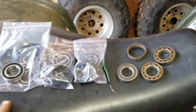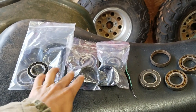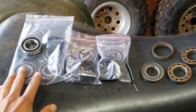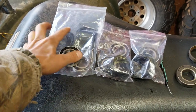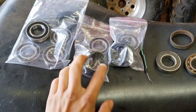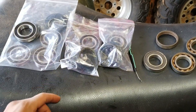These were originally Koyo bearings. They don't come pre-covered in grease — all this red grease is my doing. Here's the rear and front: we have four bearings for the rear, two oil seals, and there's an extra seal because I ordered one for the diff. So it's two oil seals, two oil seals, two bearings, two bearings — eight bearings in total.